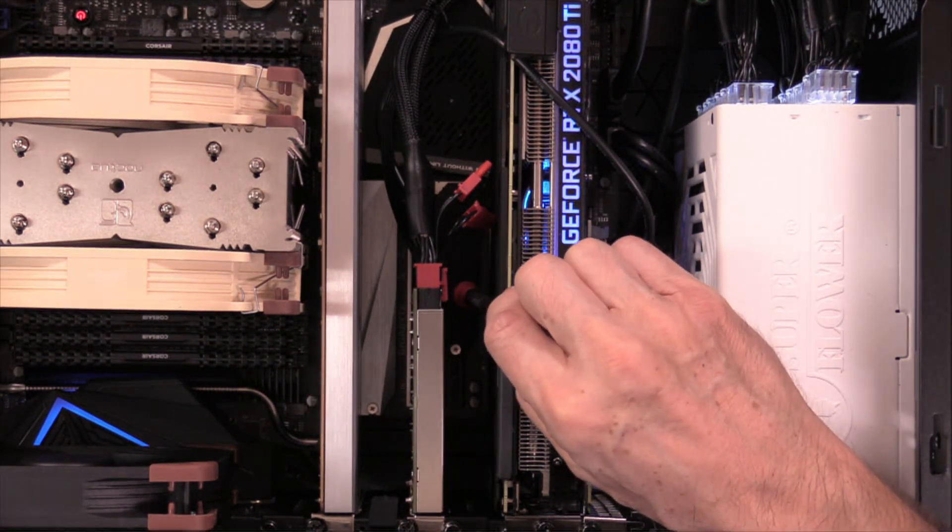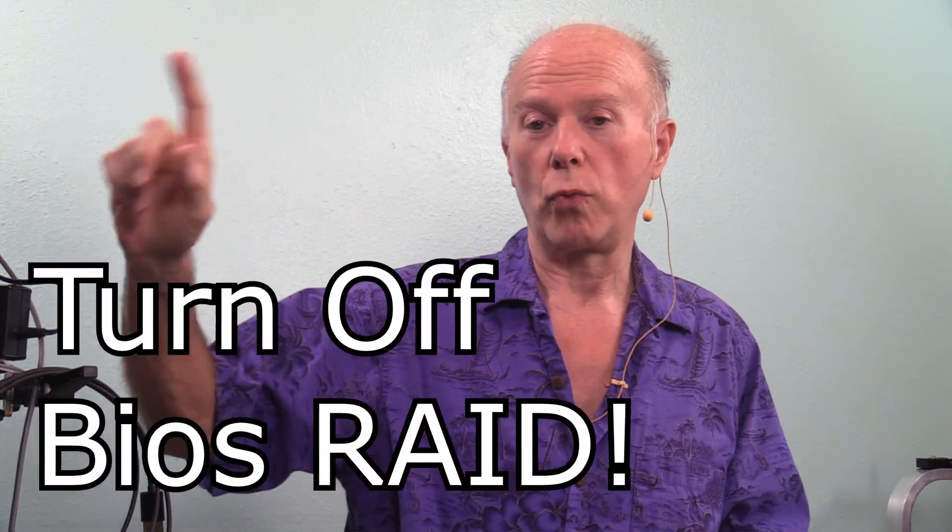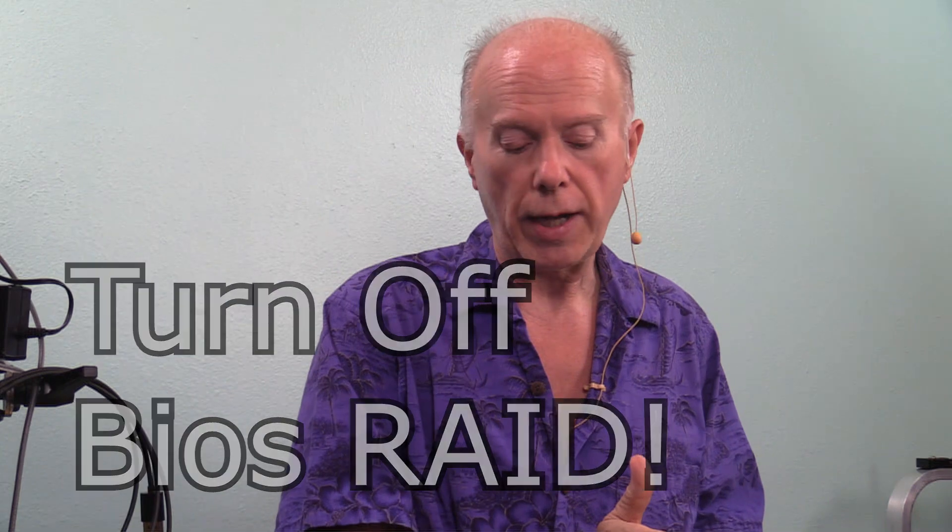To be able to test, we're going to have to be in this slot, and not being able to see those sensors in that slot is a big deal. Our intention was to move on to the Cable CC card, but David asked the question and he's right. This is important: if you put those drives in RAID, you want to be able to update the firmware, and the firmware has to be updated when the cards are not in RAID. We have to be able to see them.